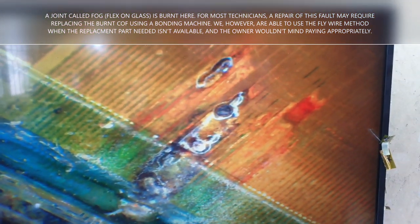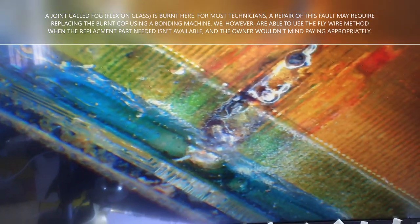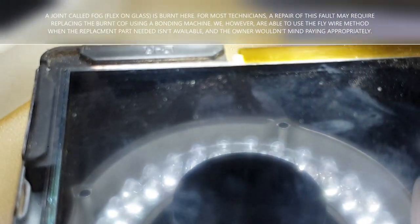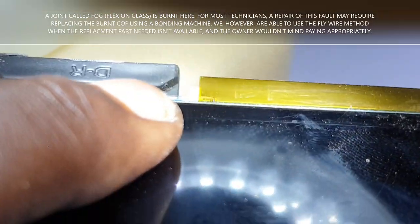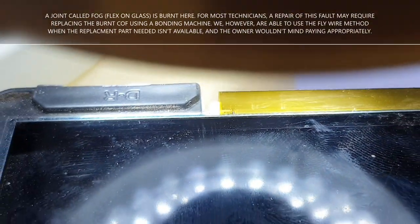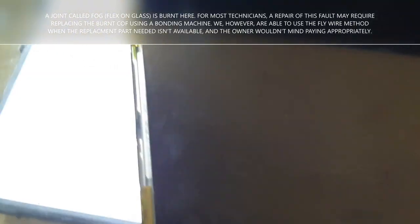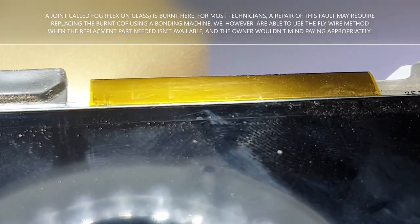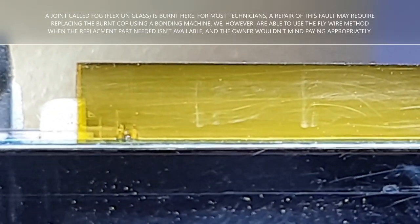With the aid of this digital microscope, we're able to see clearly where the problem is. It magnifies the point where there is corrosion. This may have been caused by just a tiny drop of water — perhaps from an AC unit — landing at the wrong place, creating a spark and a short at critical voltage points. The problem with this screen was that it showed no picture — a blank screen — because the protection built into the screen kicked in whenever it sensed that short, cutting off voltage and signals to the screen.